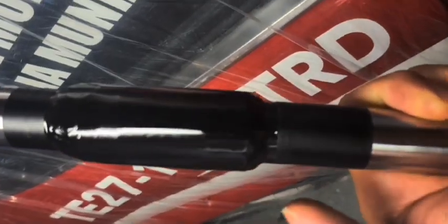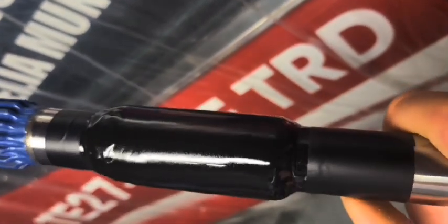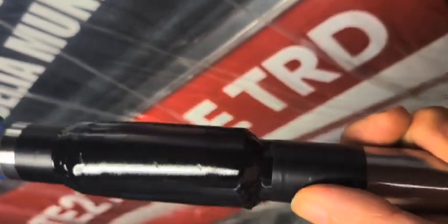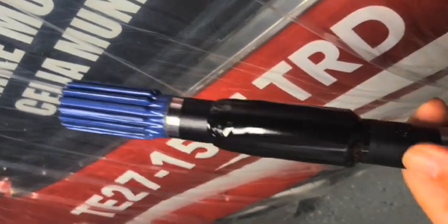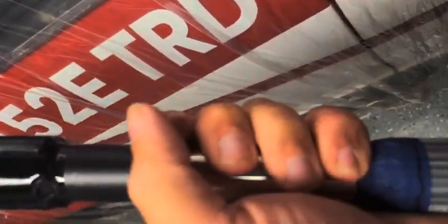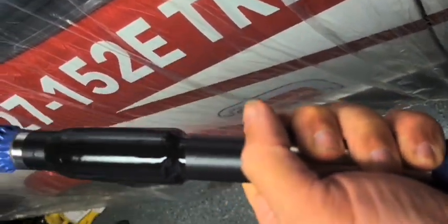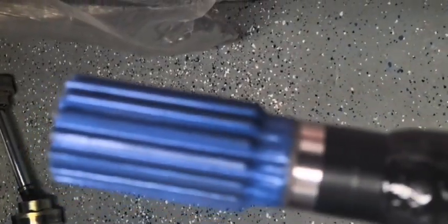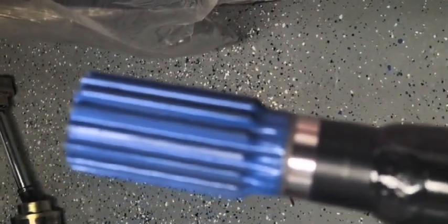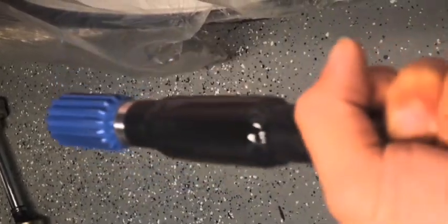Welded. That's the sleeve — I ground it down a little bit at the edges and put tape on it just to make it look pretty. On this bottom side, once I notch this for a ring, I can attach that CV end to this. The other side will go to a slip yoke that goes to a U-joint. That should cure my vibration problems with my driveline.